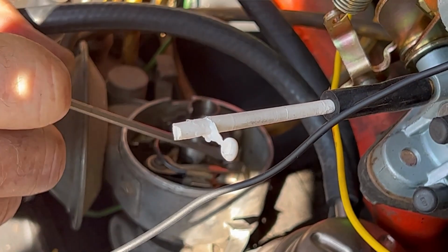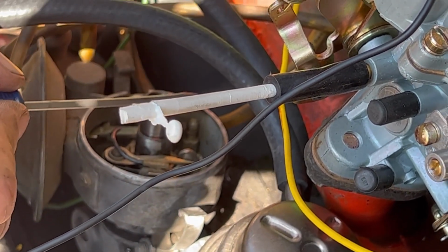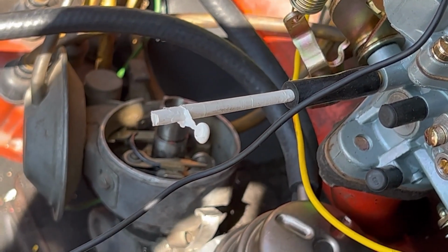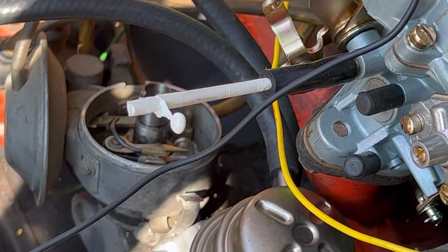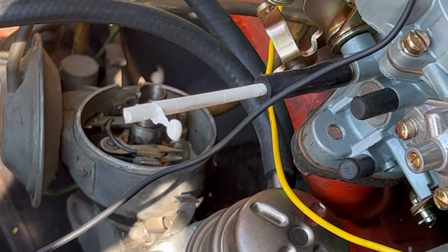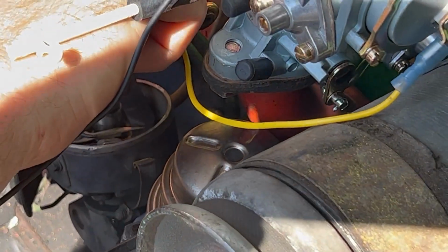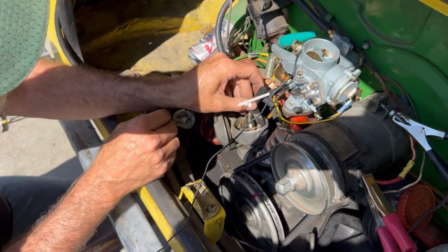So as it wears, the points get closer together, and as the points spark, they get spark erosion, and the gap gets farther apart. They get crustier. Yeah, you're just doing EDM in there, basically. And it's like copper points? No, there's some alloy. I'm not sure what they are. The points today maybe aren't as nice as the older points, but good points last a long time. And that phenolic bearing is basically just so that it doesn't short out. Or not phenolic, but the fiberglass. So see, these are too close.